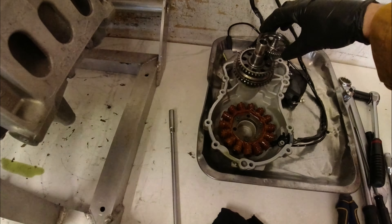The clutch nut is undone. I can slide the entire clutch straight out, making sure to get the washer off the back — it's sticking with oil, so I'll leave them together and pop them in the box with the other bits. Then I need to hook the bearing out of the middle of the clutch with a small pair of pliers so I can wiggle the basket off, because the water pump and oil pump drive is driven off the back of the clutch basket.